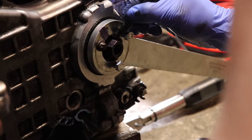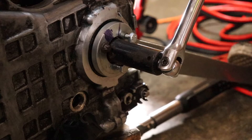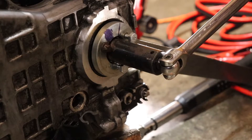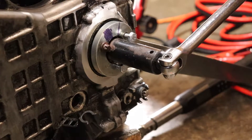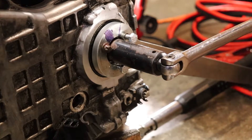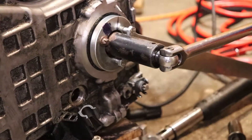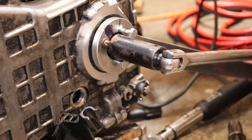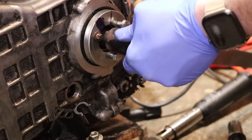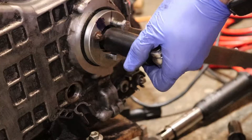Alright, I'll mark it here for a double reference point. Is this VTT's torque spec or BMW's with VTT's? But BMW does this too. At this point it's a two-person job — even sitting on the bar it wasn't going. We still had some feet on the floor — do not underestimate the force required here. The main crank bolt definitely requires serious effort and may need two people.